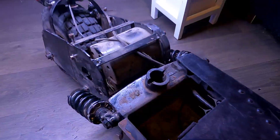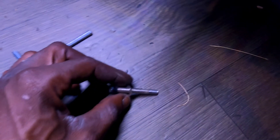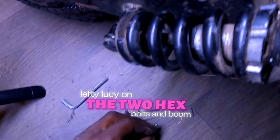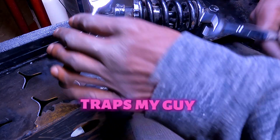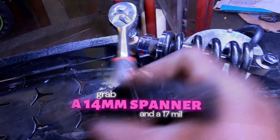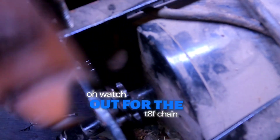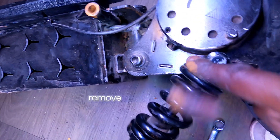First up: motor swap. The stock motor is trash — a tired 800-watt brushed DC motor with two wires and no dreams. Using a junky allen key borrowed from my girlfriend's kitchen drawer, lefty-loosey on the two hex bolts, and off comes the motor. But this scooter has booby traps — to slide the motor out you gotta move the suspension shock. Grab a 14mm spanner and a 17mm wrench, swing the shock to the side, and watch out for the T8/F8 chain hanging on — remove that too.